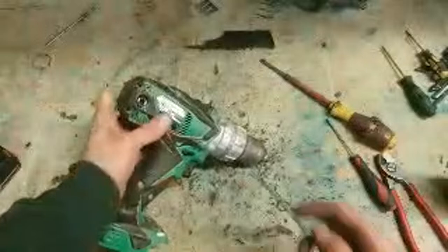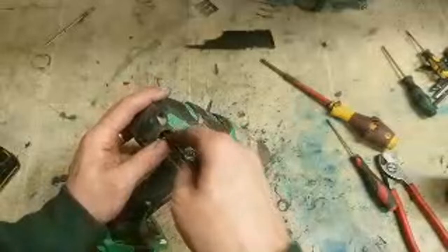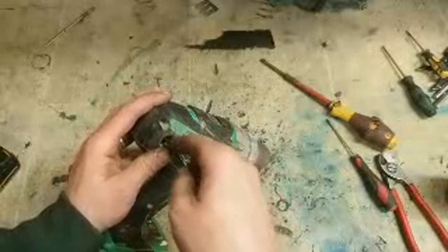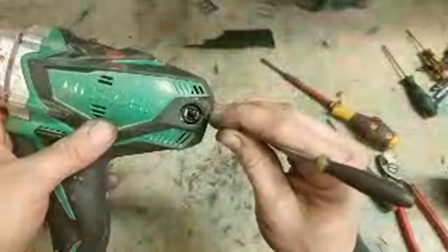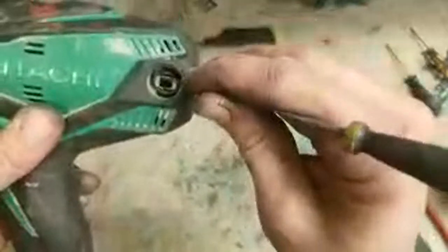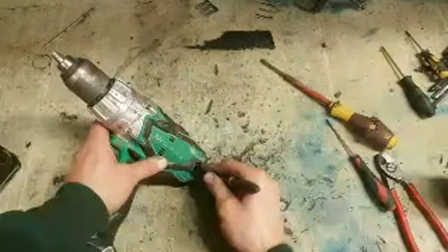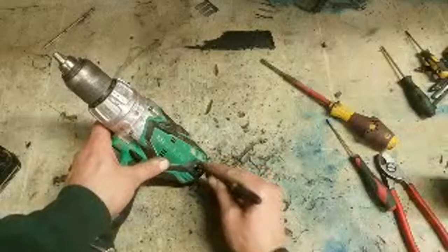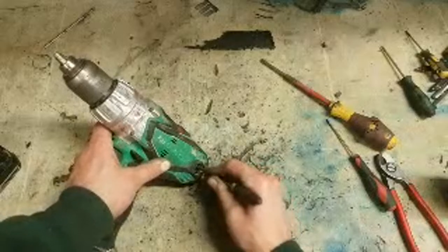That means these here are sticking on the holders as well. And this would be a fairly common one for the Hitachi stuff, for these brush drills. Really very little meat on the plastic. And these wee brass holders as well. See, they're playing that now. Not an awful lot holding them on. That actual contact to that wee plastic ring, fairly small. There's just not enough heat dissipation to take the heat away from them brushes.